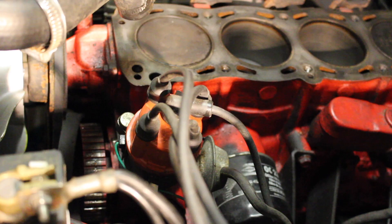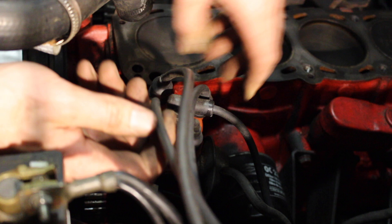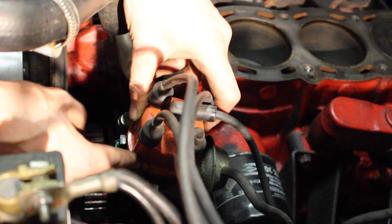You need to be looking in line with the notch when you're lining it up. It's also a good idea at this stage to set the timing on your distributor just roughly, so you know you're not too far out. Spark plug wire number one is this one here — it's the shortest lead.